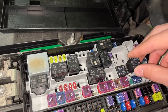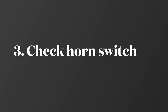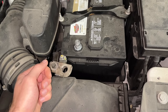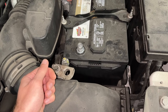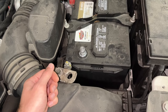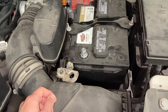I'm going to put my relay back in and move to working inside the vehicle. Any time you're going to be working inside the steering wheel or anywhere else where there are airbags, you should disconnect the battery and let it sit for a while to make sure there's no charge built up inside the airbag that could set it off. I disconnected my battery last night and it sat overnight, so now I should be good to go to work inside the steering wheel.